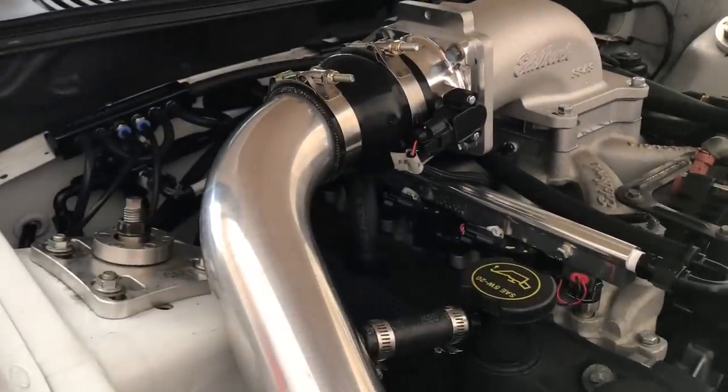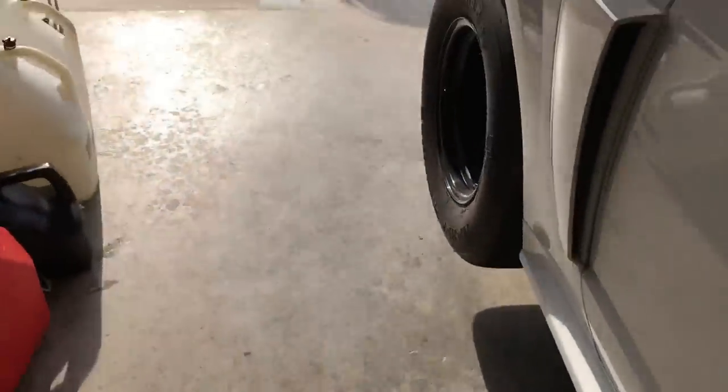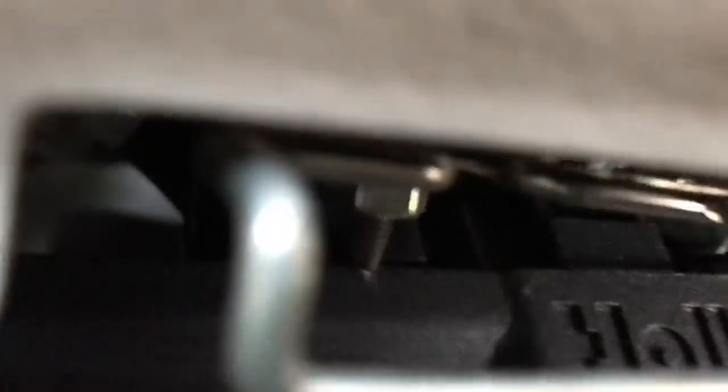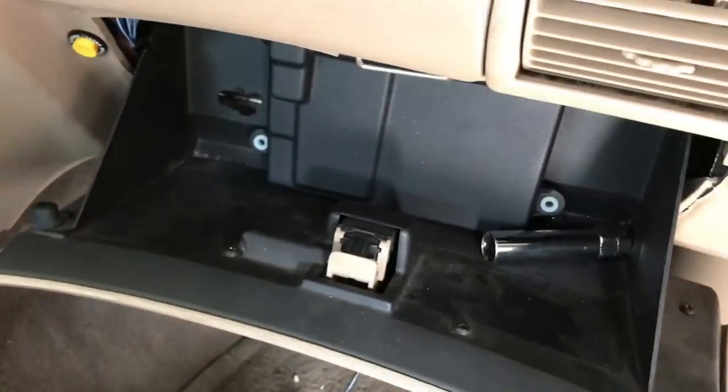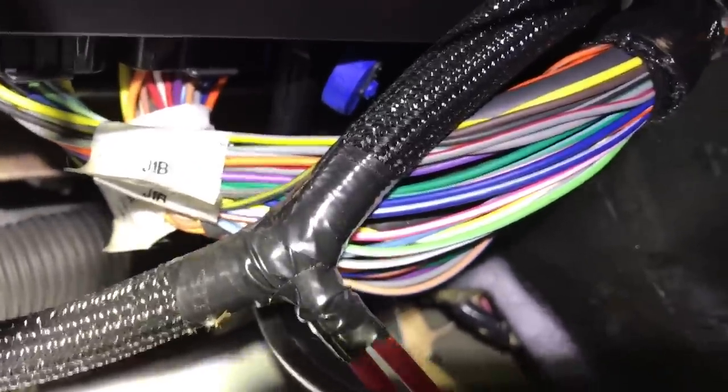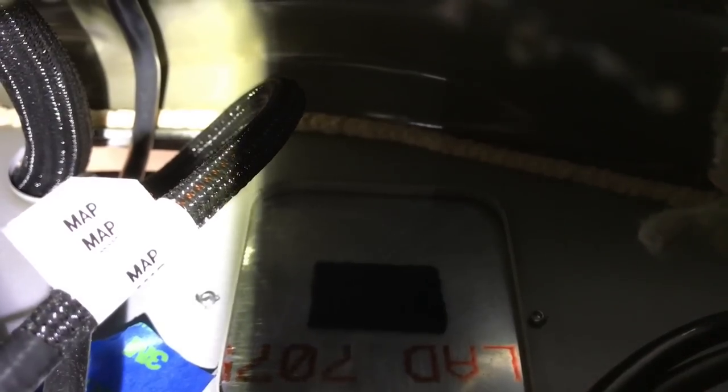A couple of guys had questions about how the Holley is mounted in the car. What I chose to do was mount the ECU in the glove compartment. As you can see, the ECU sits right there in the glove compartment. There's still room in there to put stuff, even though I don't really have a need anymore. It's kind of hard to get the phone in there, but there's the ECU up under the dash. You can see the top of the ECU and the wiring bundles coming off of it. I ran those bundles up here to the hole in the firewall where the AC system used to come out.